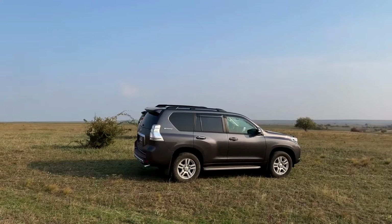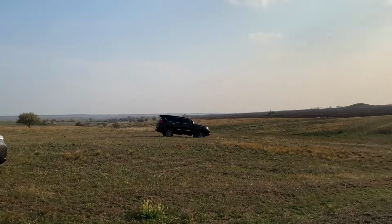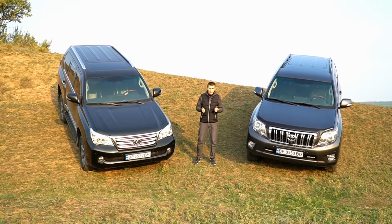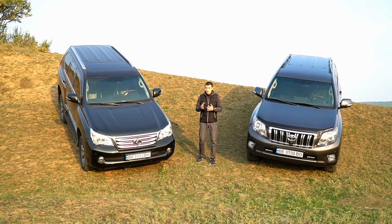Often after removing KDSS, it is also necessary to readjust the rear air suspension, raise it a little higher to avoid bottoming out, as the vehicle has become softer. So, the conclusion. The car is completely ready, converted from the KDSS system to a regular stabilizer. What did we achieve in the end?